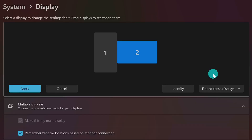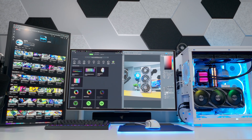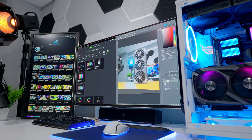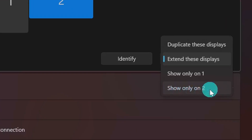If you plan to use your monitors as one big desktop, come over here to the viewing mode and set that to Extend These Displays. You can also choose Duplicate if you want both screens to show the exact same thing — useful for presentations where one screen faces you and one faces your audience. Generally, most people will want Extend so they can use the main monitor normally and have secondary screens as fully usable, full-resolution additional workspaces. If you have a laptop with an external display connected, you can select Show Only On Two to bypass the laptop screen and see everything on the external display.